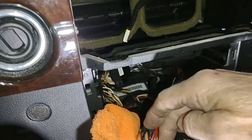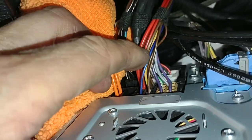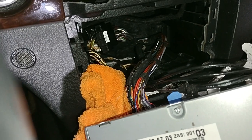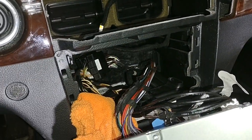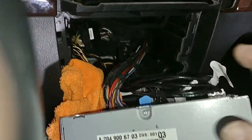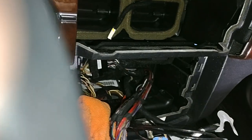The blue wire coming out of the back of the head unit — the control unit — goes to the top corner of this big plug here. It's for either the power antenna, which this car never had, or the power amp turn-on signal. That is going to provide plenty of power for this little camera. I'll have to run a wire from here on back, but I have to run the video cable all the way back anyway — so all I have to do is run two instead of one. Save me a lot of time.